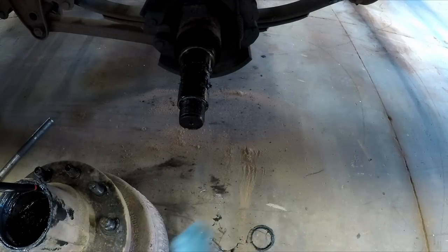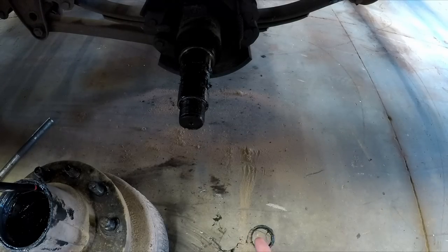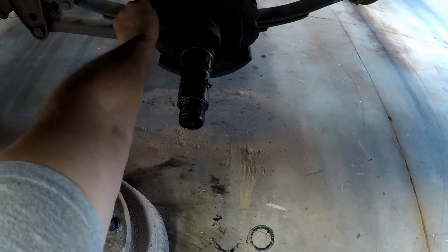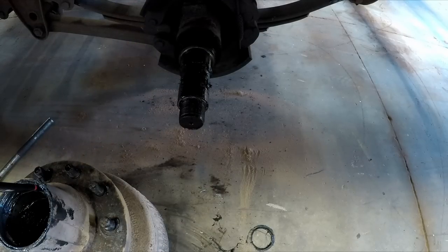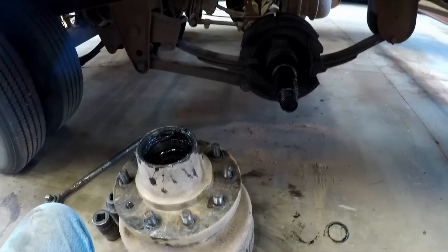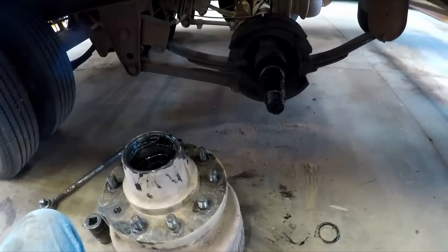Like I say, the reason I'm pulling these is I believe these brake drums are to the point of no return. You can see my brake shoes are fair — well, that one is down to the rivets. They were done. But once your drums get worn out, it's time to replace them, because if we put new brakes on there they're not going to run as long and we'll be back in the same boat.